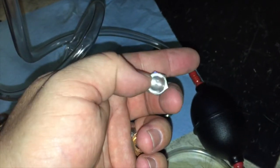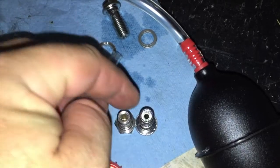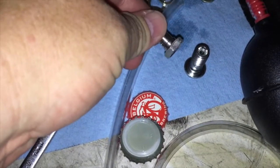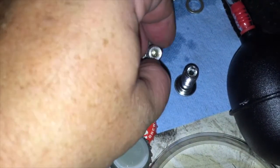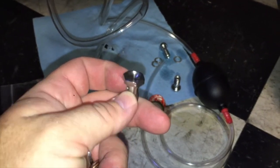So there's a couple things about these. These are nicely made. Look, they're nicely shaved out here in the bottom. These are different sizes than the factory. These look like they're about 14s. The originals were 12s. But what you don't see that often is the orifice size. Look how thin that orifice is. So you imagine how much liquid goes through that versus this big fat one. That's a lot. So you look at the accompanying holes on the side. There's two holes. One. Whoa. One and one hole. That's it. One hole. So this one, not only is it a fatter hole, a fatter orifice there, you get two holes squirting the fluid all over the joint. How cool is that? So it's not just the brake line that's an advantage. It's the fluid delivery, in my opinion. And the cool shaved nuts. Wait a minute. Did I just say that?